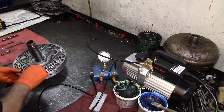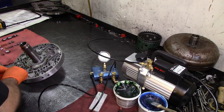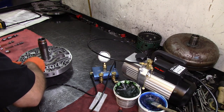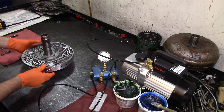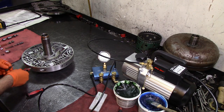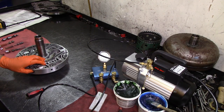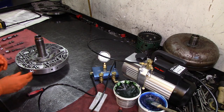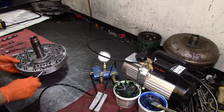Just remove these — the thermostatic valve is right here in the pump, and this is the cooler bypass valve. There are some differences between the early models and the late models, so we have to be careful. If there is a way to interchange the pump, I can look in one of my ATRA seminar manuals. I'd rather just get the right one and install it — that stops all the hassle, especially if you're turning a lot of transmissions per week.